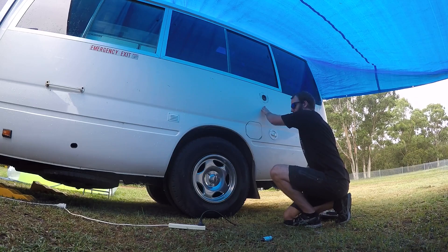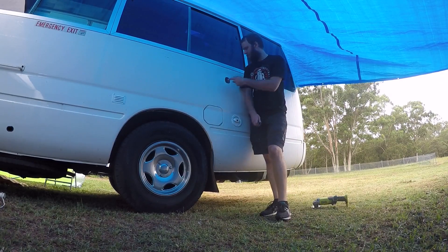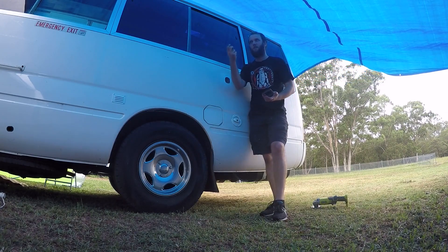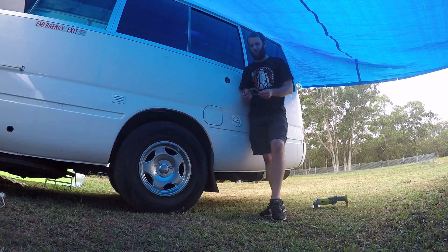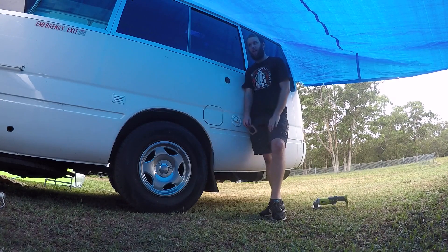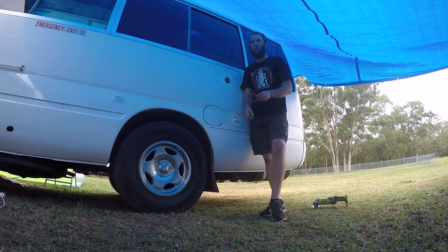Don't use the jigsaw on the outside of the bus. Here are the holes for the inlet and the outlet. The instructions for both are exactly the same — you stick the foam on and attach the bracket piece with the main bit using 6G 30mm panhead screws. There is a mounting adapter if your wall is too thin, but I think the depth is enough so I'm not going to use it.